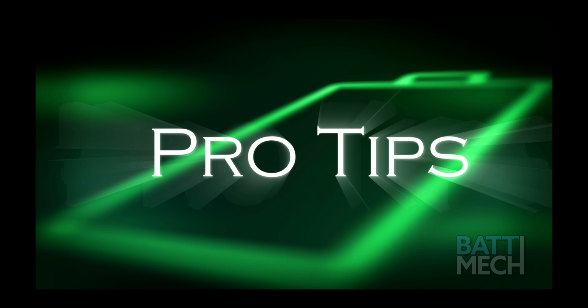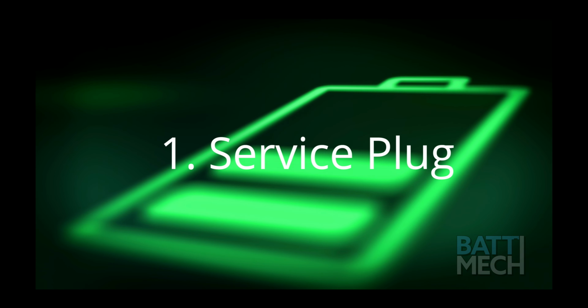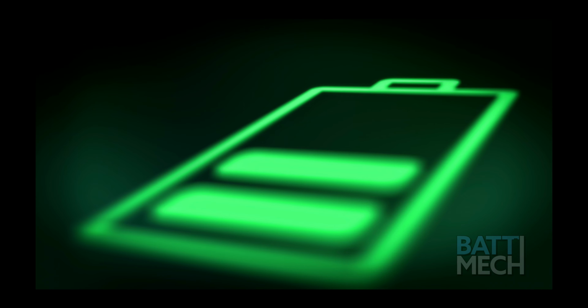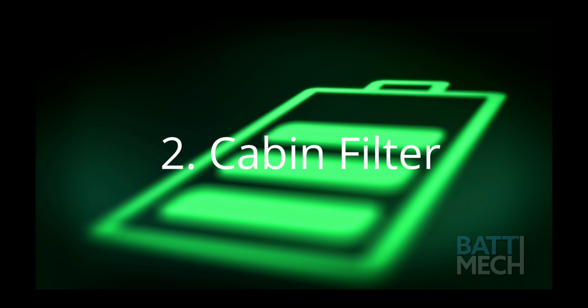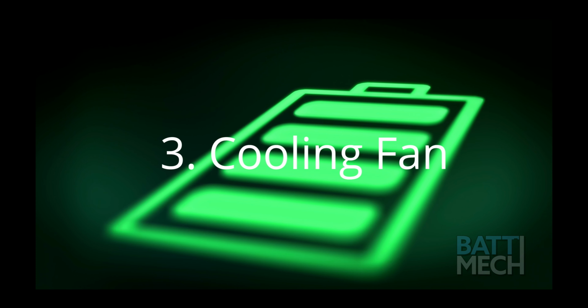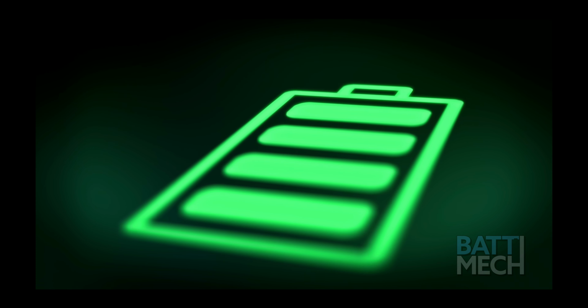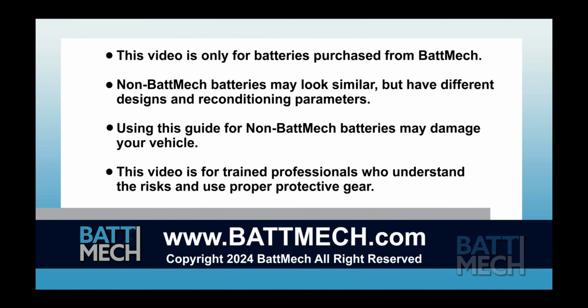Here are a few pro tips. Be sure the service plug is secured properly, otherwise you'll get error codes. You'll also want to clean your cabin filter every 3 months. Be sure to clean your cooling fan. Dirty cooling fans can cause the battery to overheat. This concludes our how-to demonstration.